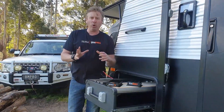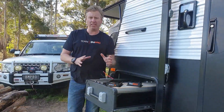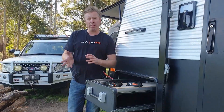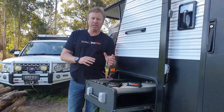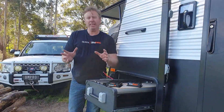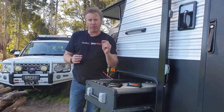Now on all of the positive lines, good electrical wiring would dictate you put fuses onto each of them. So we'd be suggesting you put a 30 amp fuse onto the positive side for your solar and your auxiliary, and also your secondary battery, just as good practice. Now of course, one of the big things you've got to make sure of is that your wiring is of the right diameter — the right thickness.